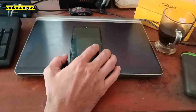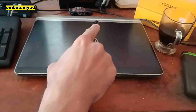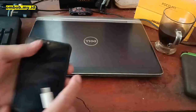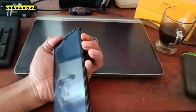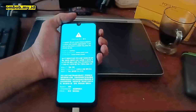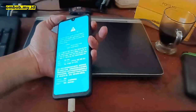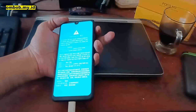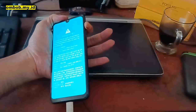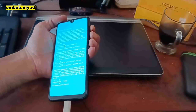For the next step we need to unlock the bootloader. Enter Download Mode by pressing Volume Up and Volume Down at the same time, then plug in the USB cable. You will see a confirmation screen — it's in Korean. Long press Volume Up for about five seconds until it shows another confirmation. Press Volume Up once to unlock the bootloader.